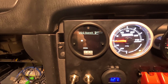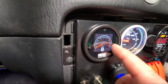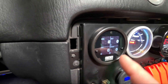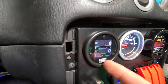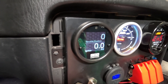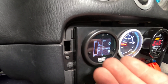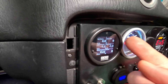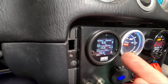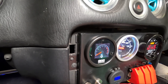If you've got a CAN Checked gauge, comment your best Pong score below! As you can see there are lots of options to choose from: an RPM gauge, RPM with clutch and intake air temperature and vehicle speed all in one, intake air temperature in a bar graph, a digital boost gauge, throttle position and ignition advance, battery voltage, exhaust temperature, fuel pressure, map sensor, voltage and speed, and clutch position — and I'm sure there are many more. Once plugged into the ECU we can program all of this and choose what we want to see.